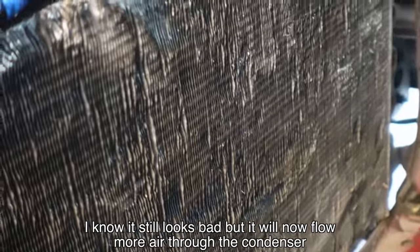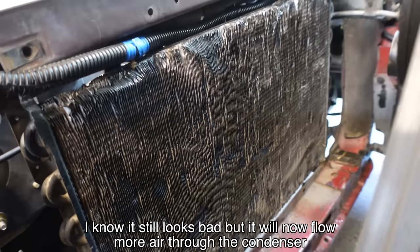Let's go ahead and cover the issue of not buying a new condenser. It's always good to save a buck, right? I know there are fin tools you can buy and rake through your radiator or condenser, but why not use what's on hand? Also, if you've ever used a comb tool, those big flat areas are really hard to manage — you can actually mess your radiator or condenser up worse than it was. This is probably one of the main reasons your car runs hot, especially after you replace a radiator and just can't figure it out. You replace the fan — it's probably the condenser. The condenser was so beaten and banged up that no air could get through it. I think we fixed this one good enough. The biggest thing to take away from this: bend your fins back enough so air will circulate through them. It doesn't matter if they're not perfect — they just need air to move by them. Next up, we'll put our adapters in the new radiator and put this thing back together.